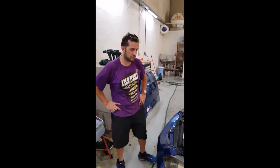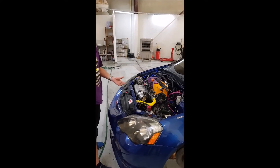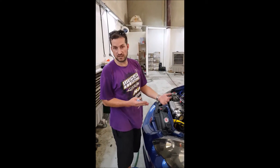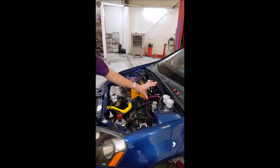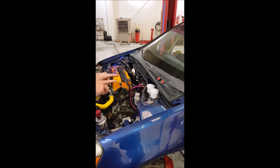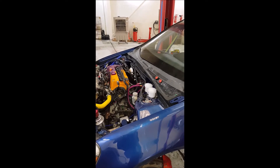So we're back at the front end of the vehicle — the business end. Now what we've got in here is something a bit different from factory. Class rules, or for most motorsport rules, you have to have a front and rear biasing independent brake system. So what we've done here, from a company called Comp Brake in the UK, is we've got a box that has two pistons instead of a conventional one, and that has the bias adjustment screw in it, which we have a control for on the dashboard. So we have two fully independent systems, front and rear.